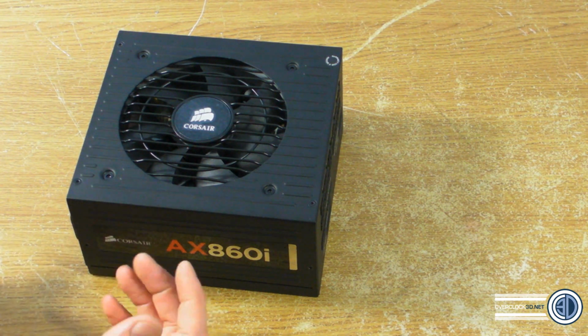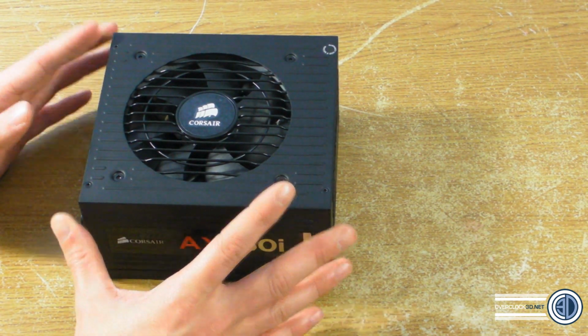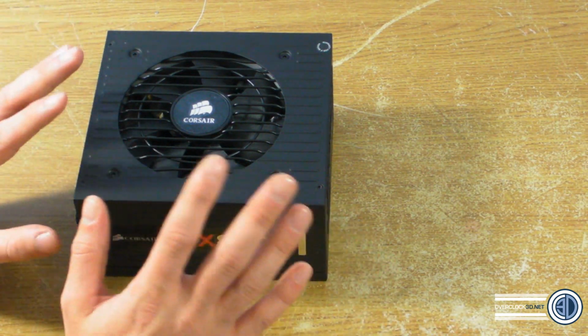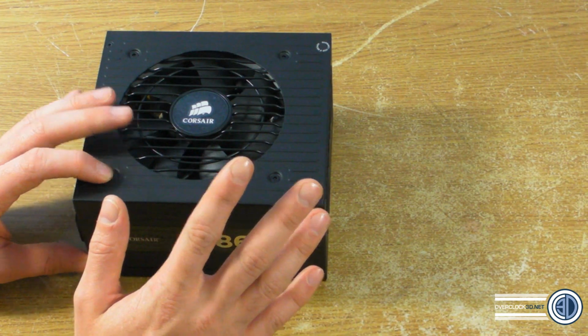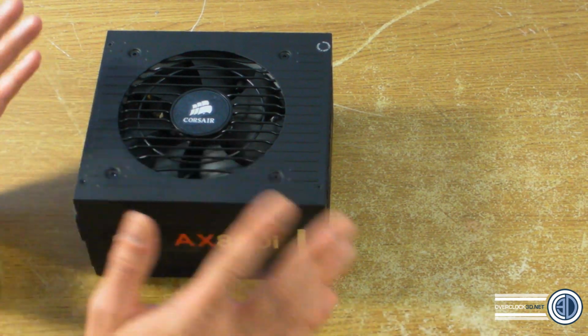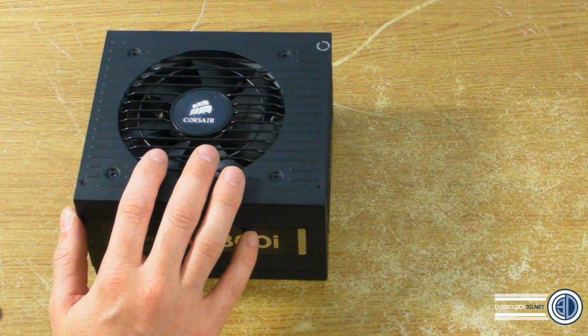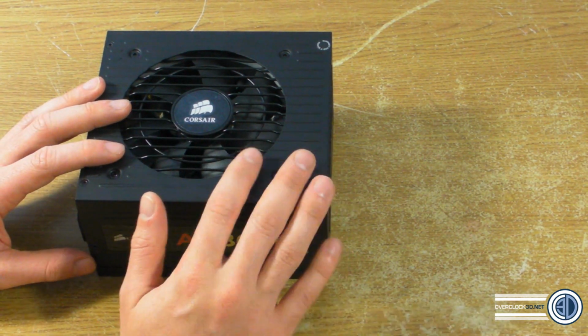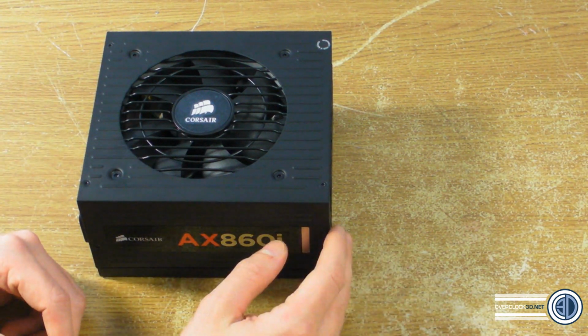The normal ATX specs, you know, for generally every power supply on the planet, just for it to be able to be called an ATX power supply, this actually can be up to 3 times better than they want it to be, which is quite a clever thing, really. Now, all built in inside, you've got overcurrent protection, over temperature protection, over voltage protection.